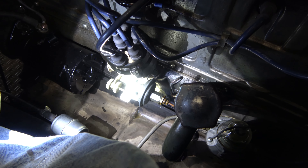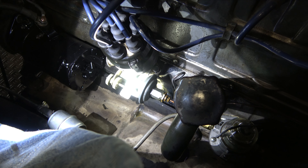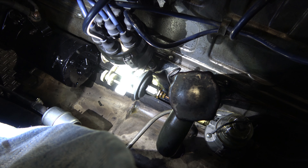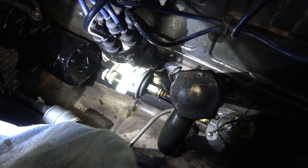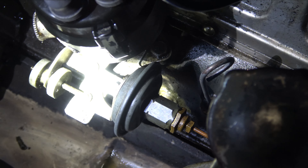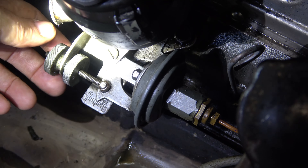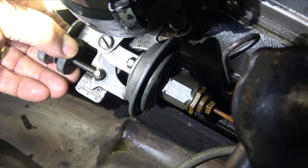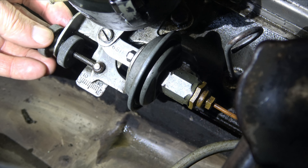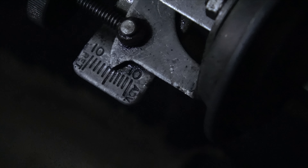It depends on whether you live in a very cold temperature area or whether you live somewhere very hot like Arizona or Utah, out in the desert. You can actually set your timing manually by a few degrees plus or minus so that the engine will run at its optimal peak with the type of gas that you're using. In order to set the timing on a 6-cylinder like this, you always need to revert back — no matter where this has been set previously — you need to bring it back to dead zero. That way you set your little thumb screws to dead zero so that when you do set the timing, everything is synchronized.